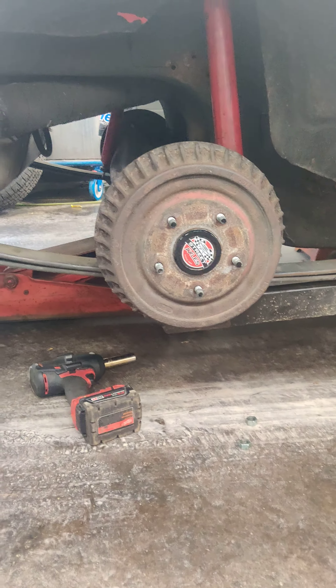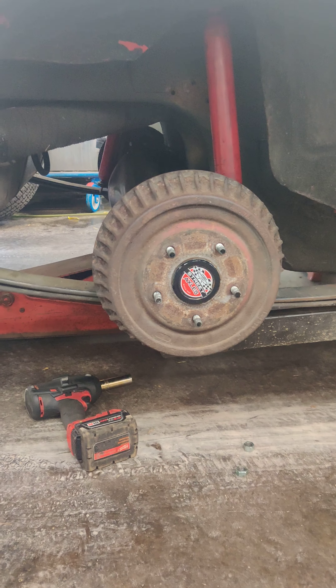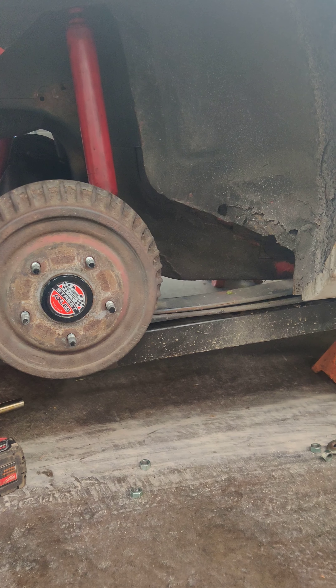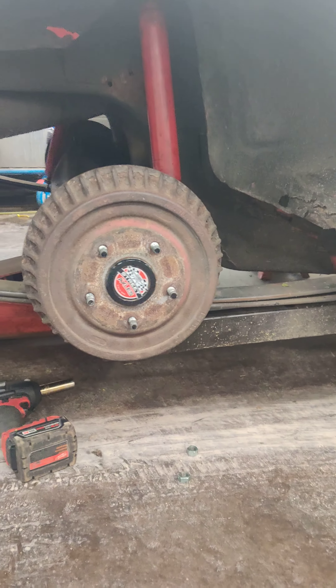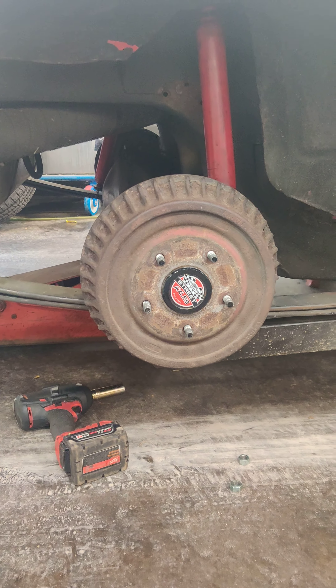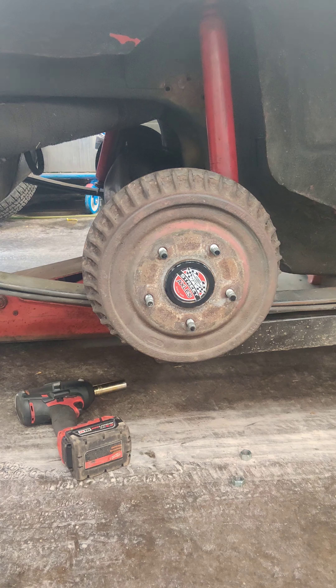So what I'm trying to do is get a little more separation on the rear here. I'm going to take a leaf out of my leaf spring and hopefully soften up the rear a little bit. Maybe it'll separate better. May do some stuff with the shocks too.